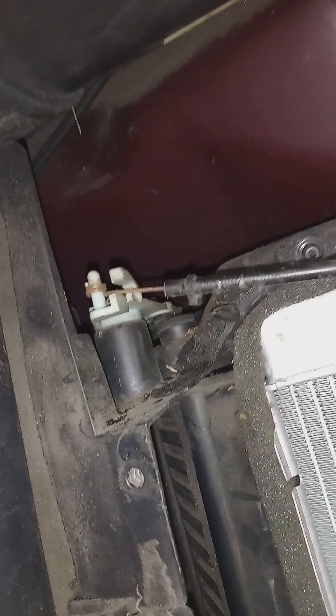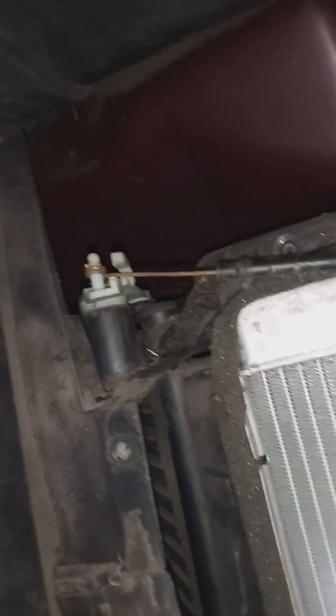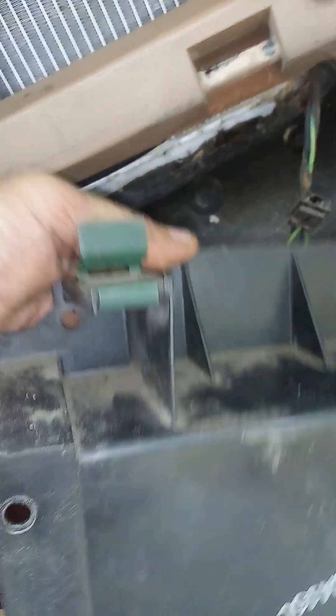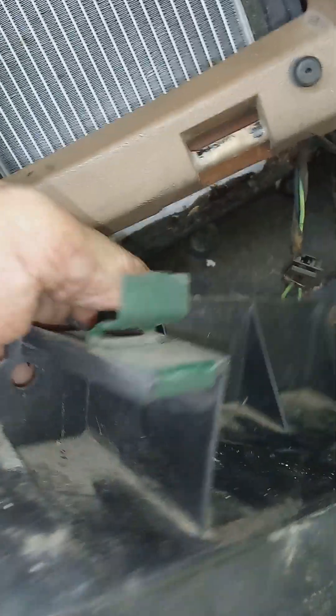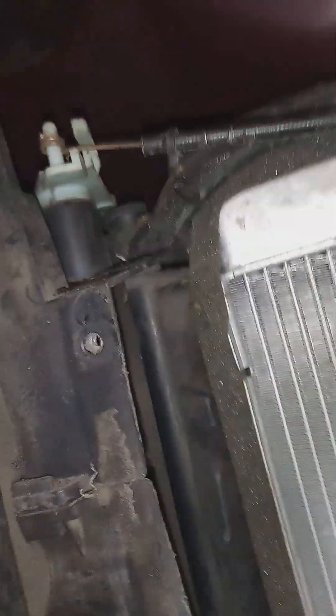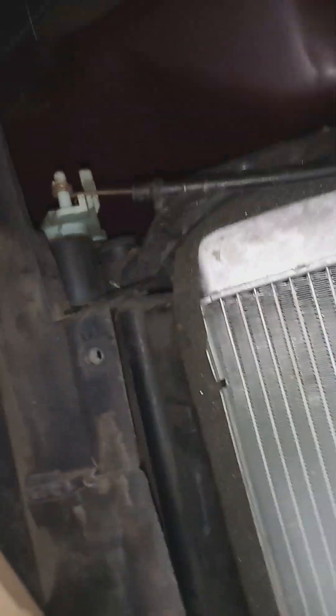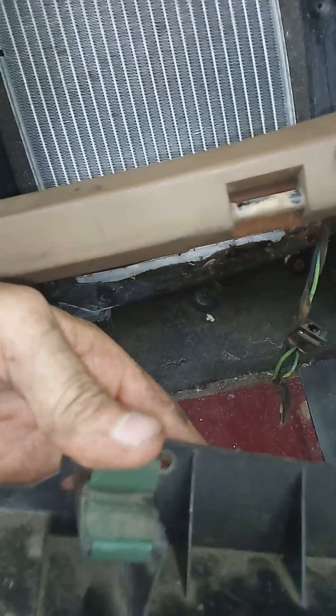You can see the outer cable moves, but that's not a defect because on your heater core cover right here — which I have disassembled — is the green clip that will keep that cable from moving. So right now it moves and that looks like a problem, but it's not, because when I put the cover back on, that green clip will hold that cable.